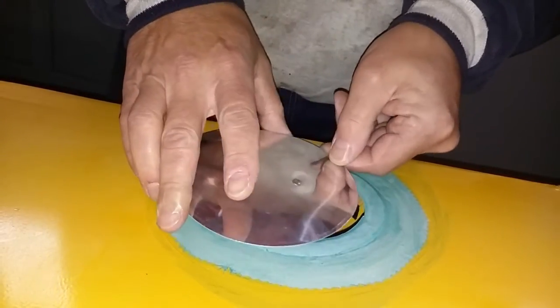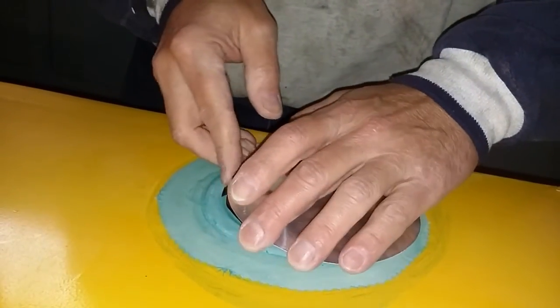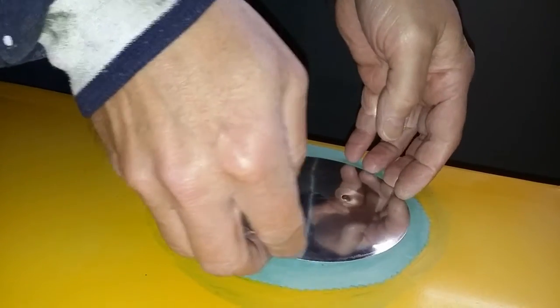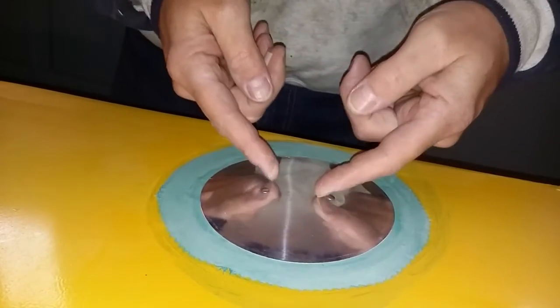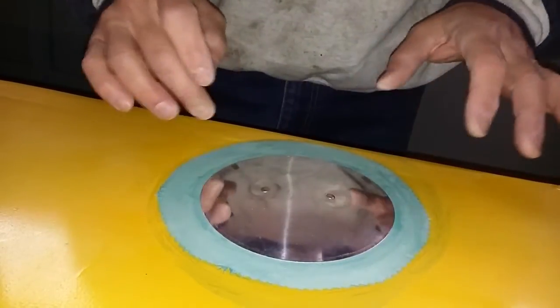The inspection ring then catches on here — the inspection panel pushes on and so forth to get a nice seal for the wing. I bought these at Aircraft Spruce; they were about $2. I made the doily patches out of Dacron aircraft fabric.